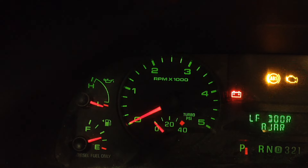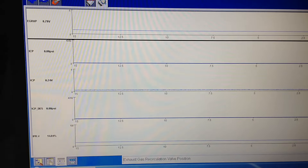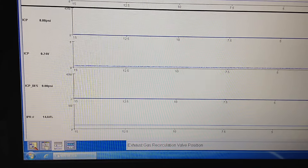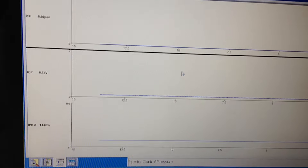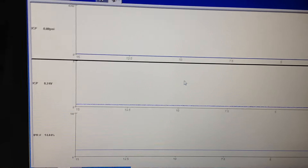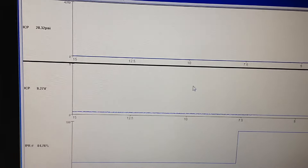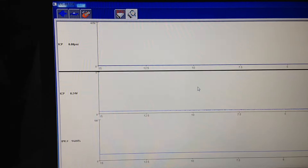Next, connect your scan tool. If you own a 6.0 or even a 6.4, you're going to need some kind of basic scan tool that shows codes and basic PCM information. What you want to look at is the ICP voltage, the pressure, and the IPR. Right now we're at 0.24 volts for the ICP sensor — that's perfect for this year with no pressure in the system. The IPR is at base rating, so we know the ICP sensor is not biased. Now we'll crank it, making sure we have plenty of cranking voltage, and watch: the IPR is fully closed off and we're only getting 30 psi.